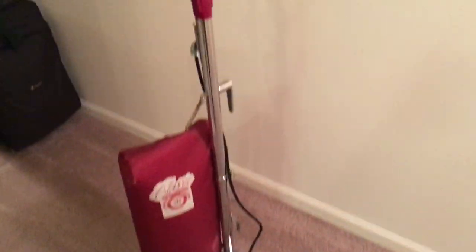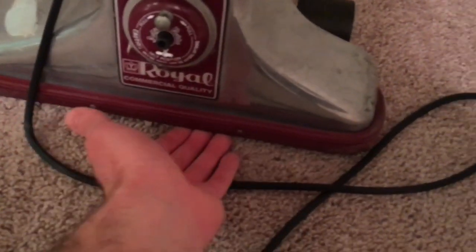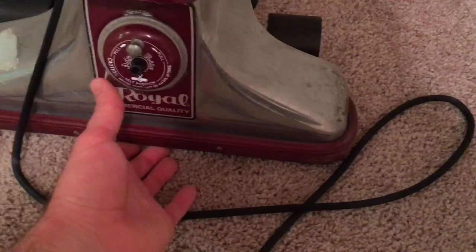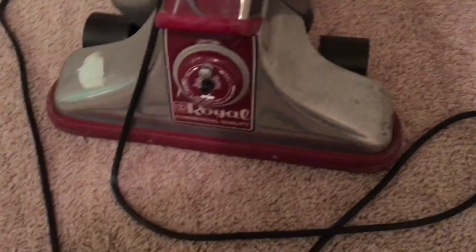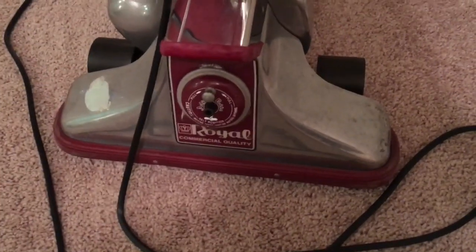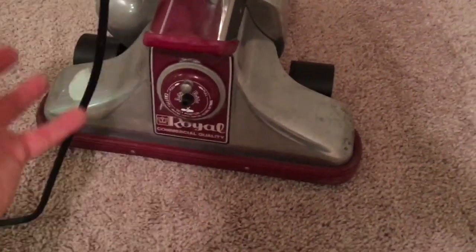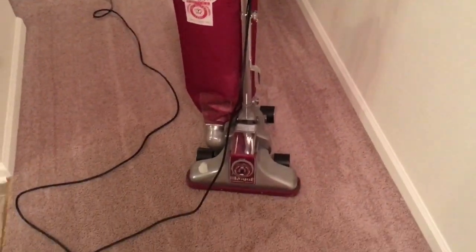With height adjustment, you definitely want to be able to feel a slight gap under there — just a tiny little bit — so that it's not totally pressed down against the carpet and it still has good airflow, but you want to make sure there's good contact with the roller brush. If you put it down too far, you're going to be burying the roller brush and you're going to burn through belts a lot faster. You're also going to restrict the airflow and it's not going to pick up as well. You need a good combination of both airflow and agitation in order for these direct air machines to work at max performance. So just keep that in mind with height adjustment.